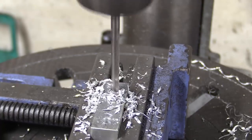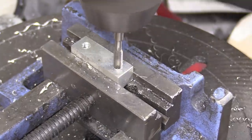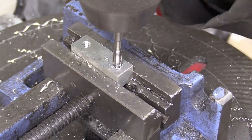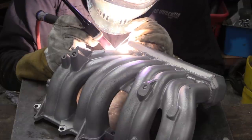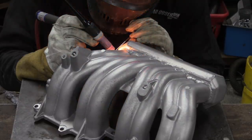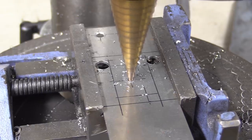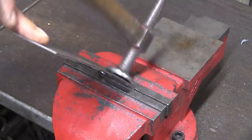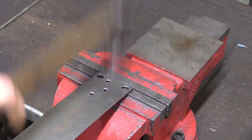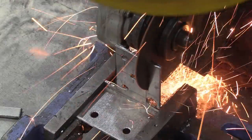I mean, it's just a case of finding a piece of real estate close to the fuel rail that isn't already occupied by something else, creating somewhere new and exciting to bolt the bracket to, using an old bit of aluminium, the drill, an M6 tap, and the TIG welder. Junking the supplied bracket because no one at Fuel Lab ever thought their regulator would be used in something less capacious than an elephant scrotum. Make our own more suitable bracket that picks up on the new boss on the side of the inlet manifold.